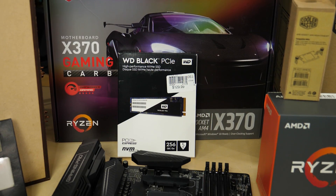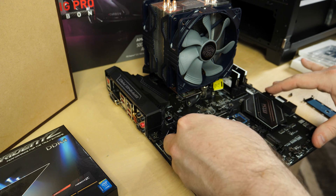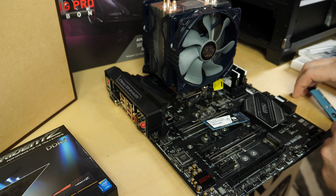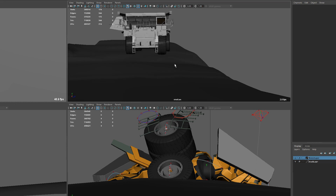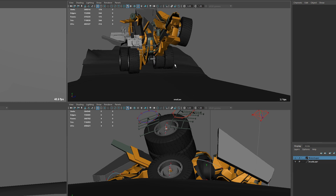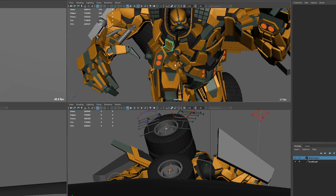For storage, we're going to use a Western Digital Black NVMe. It's a pretty good performer that was on sale at Micro Center — keep an eye out for sales. It runs really well in benchmarks. I think high-speed I/O is really important for a digital artist because you may be working with big video files or big model files, and spinning rust just isn't going to cut it. If you do need extra storage, hard drives can be added to this case.